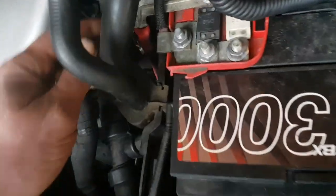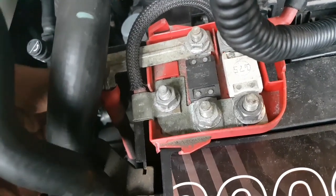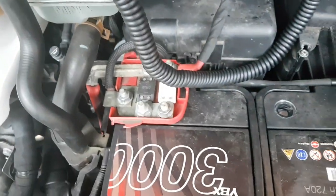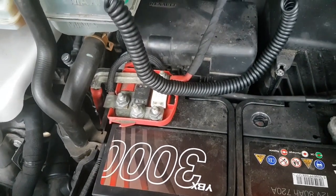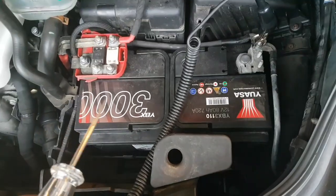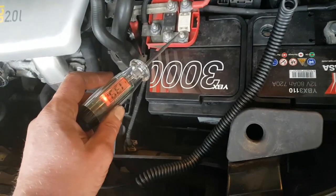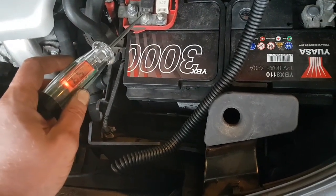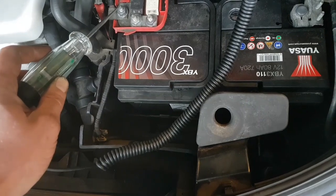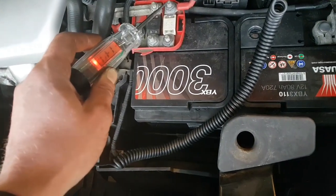All because, you can see this. Loose terminal, see the sparkiness? Whoa, look, it's deadly. There we go, nice easy fix. So, got our terminal off just to make sure there was no underlying issues there, and there doesn't appear to be. And now we have, I haven't checked this yet, I don't want to look silly, so hopefully we've got, yeah, battery voltage. Battery voltage. Battery voltage. Battery voltage, and battery voltage, and so that you can see, I'm not messing around.